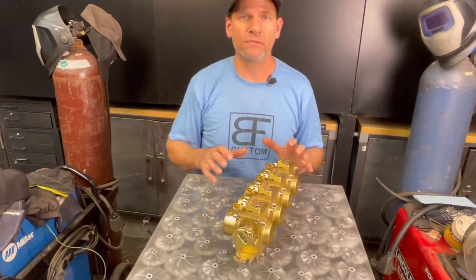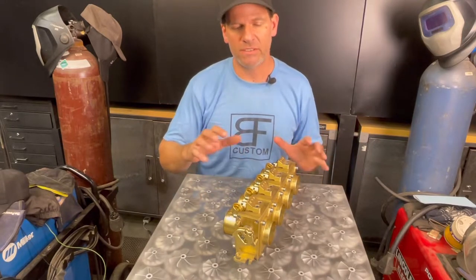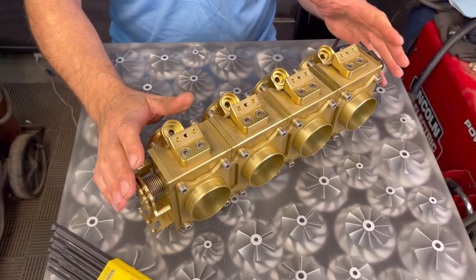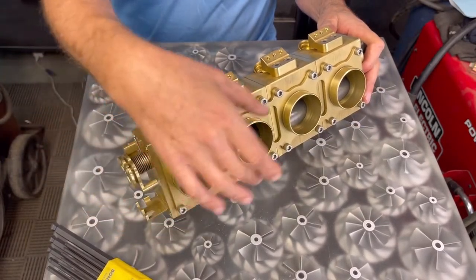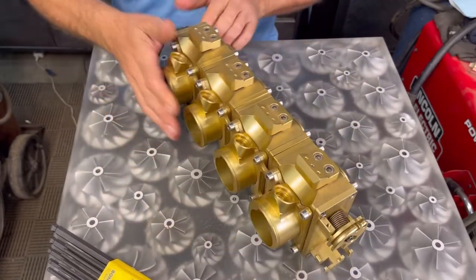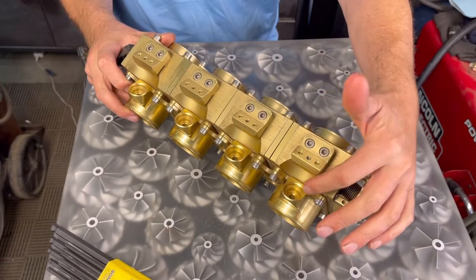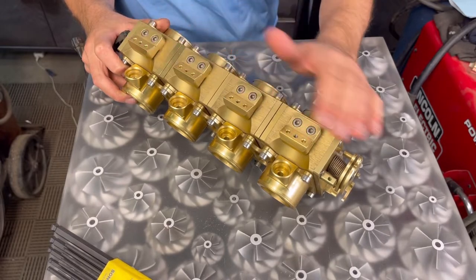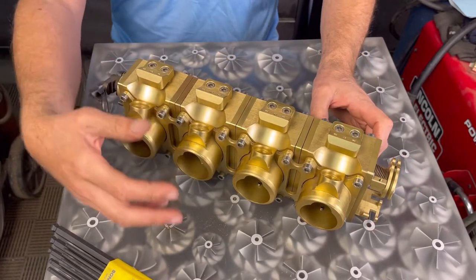So let's take a closer look at the components of the throttle body. We'll take this apart and talk about each component. This concept was actually made and tested for a Hayabusa — from 1999 all the way to, I think, 2006. The position and size of this throttle body is made for that type of motorcycle, and that's what this throttle body was tested on. You can see the actual ports for the injectors for that type of motorcycle, and the fuel rail put on here is also from that type of motorcycle. The diameter of the bores actually fits right on that type of motorcycle.